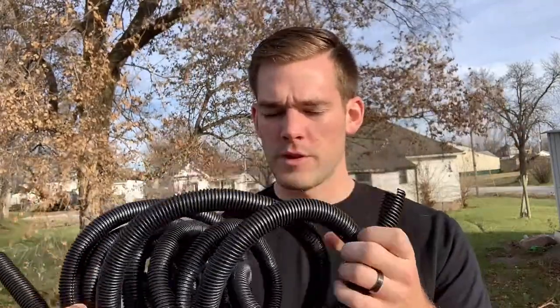What's up guys, welcome back to the channel. I've got a quick video for you today about wire loom. Everybody puts additional lights on their trucks, and especially on diesels you have lift pumps and all sorts of stuff that come with additional wires. The wire loom on your truck isn't really sufficient to add more to it, and they don't supply you with wire loom. It's really cheap, most people don't even think about it, but it tidies up an engine bay, tidies up under the cab, and it kind of weatherproofs stuff — keeps water and dirt off your wire connections.